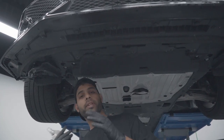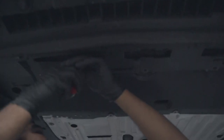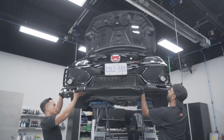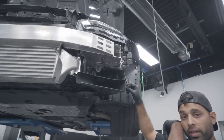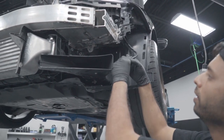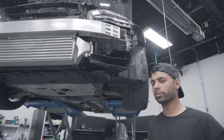Underneath, as we're removing the bumper — SI's and Type R's are slightly different — there are three more hidden clips hiding right above the rad support area. There's also an LED connector for the fog lights. You've got to snake your hand in behind, put your hand above where the fog light will be, push down on the tab, and then pull directly out towards the fender liner. It will snap right out of place.